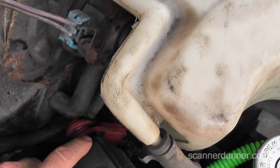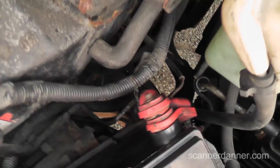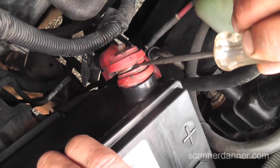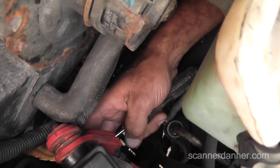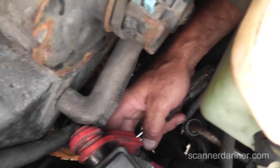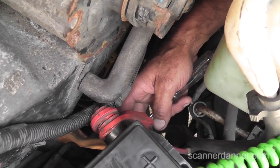Put that test light — which one's the starter? The big one outside. Can you get to it? We want to actually — oh, that's on the stud. We don't want to go there. I wanted to go down on the wire itself. If you can do that, we're putting a hole — we're poking a hole. Some people hate when we poke holes, Tim, but that's too bad. We're proving a point here.